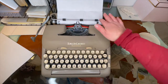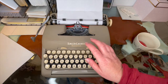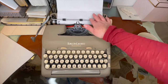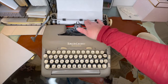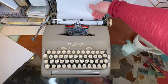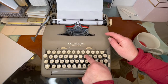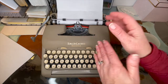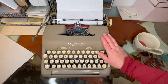If you have really old typewriters, there won't be a bar, but most of them have that bar. What the bar does is it helps hold that paper against your roller, because when you hit the key, it'll type a lot easier — it kind of eliminates air pockets behind your paper.